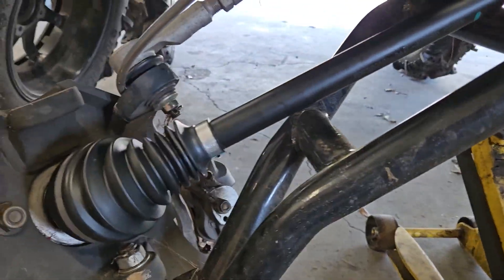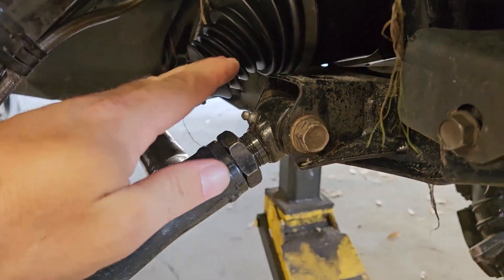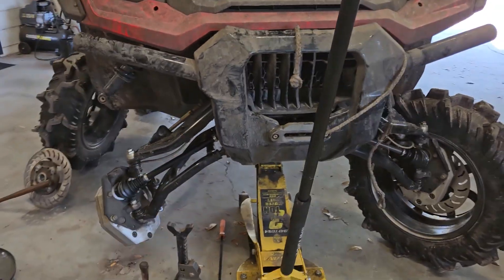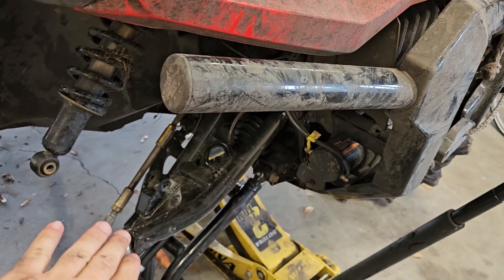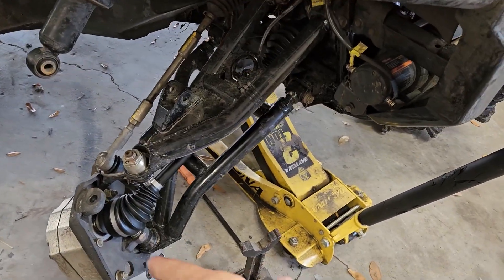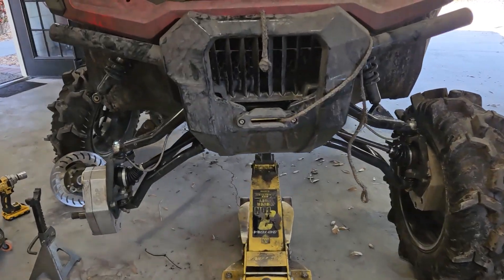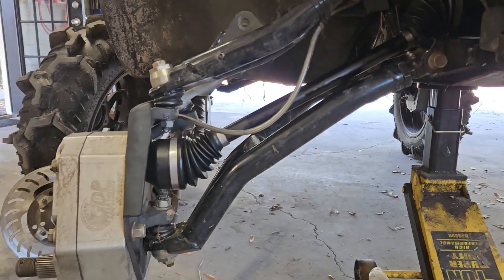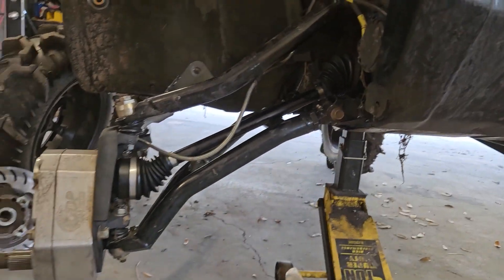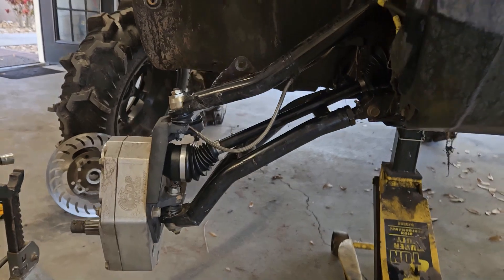I was able to sneak the axle in by just removing the upper ball joint. It's in the diff, and it can handle some crazy angles now that it's double plunging. The trick is to turn the wheels all the way to the left if you're doing the right axle, and vice versa — that puts the tie rod all the way out and lets the portal fall down far enough to give room to get the axle into the diff. I put it in the portal first, then stuck it in the diff. Because it's double plunging, you can drop it down a lot more, and I checked it — it's not binding, and the axle shaft isn't contacting the outer or inner cup. The axle shaft is floating, so it can find the best spot to accommodate a more extreme angle.